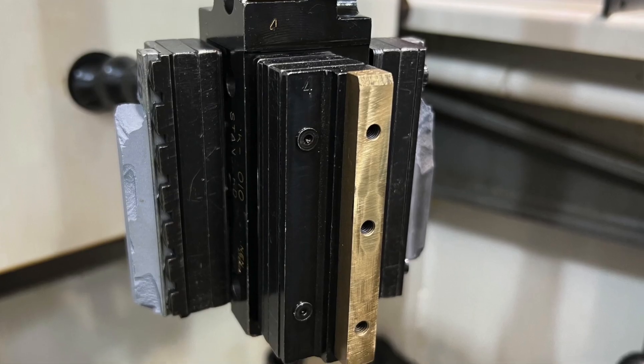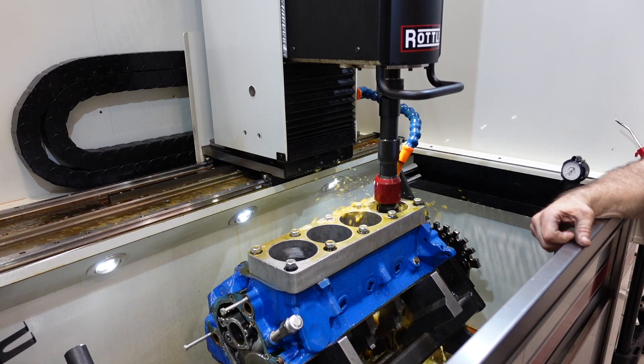The old school hone isn't going to give you the same bore geometry as a modern CNC hone — it's only got two stones, not six, eight, or twelve. So we're not saying it's going to do the exact same thing as the modern CNC hones. But in terms of getting the correct surface finish for today's rings, Bob makes it happen every single day.